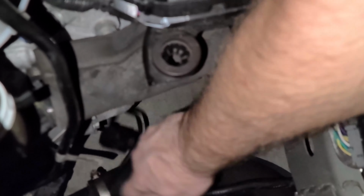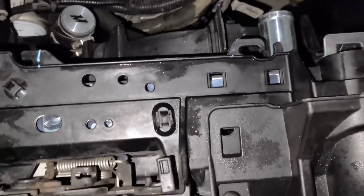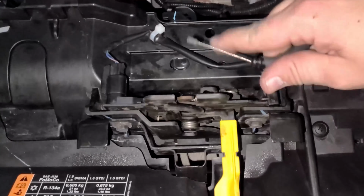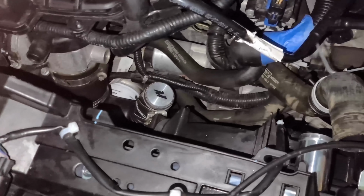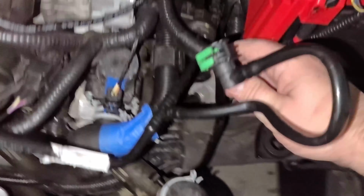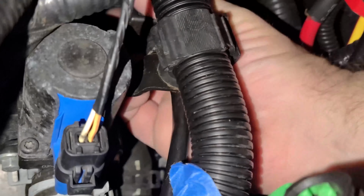Take the cables from your cooler pipe and reinsert, starting with the fan shroud connector, and work your way up. Along with these, reinstall the hood latch cable. Then cut the tie holding the radiator hose back. Reinstall the vacuum line harness onto the mounting post, and then reconnect the vacuum lines and upper expansion tank line.